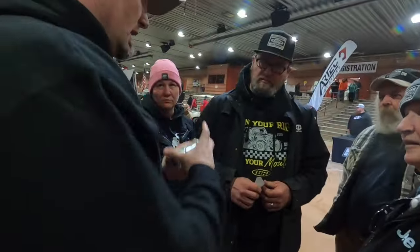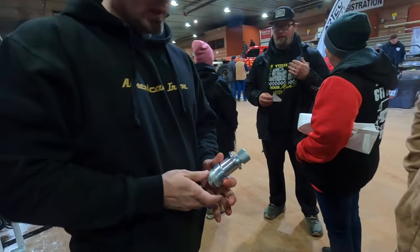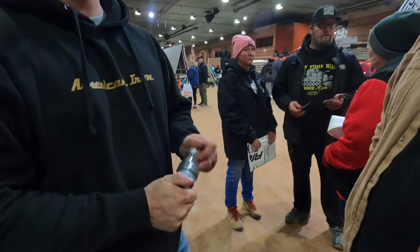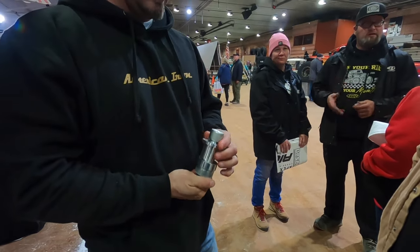We're looking at their ball joint delete. It rotates, it's clamped together, and there are adjustments. So you actually get the ability to adjust camber again that you lost when you did all your lift kit and stuff like that — which is rad. And caster. Let's talk about camber because camber disappears when we do our lift kit.